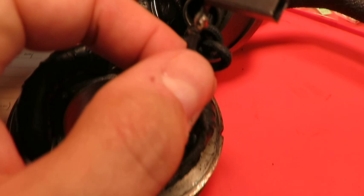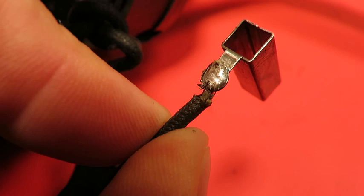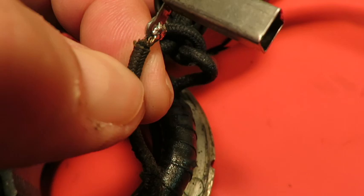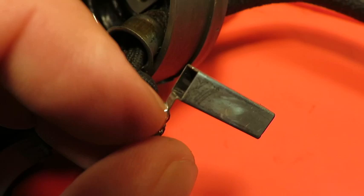And then I had to learn how to solder. I hope I did a decent job because these wires were fraying and there were at most two or three of the little wires still connected. So I unsoldered, stripped the coating back, cleaned the wire, and then re-soldered them both. There's a hole that goes through the little brass tab there, that you bend the wire through and then solder it. So I did that for both of them.